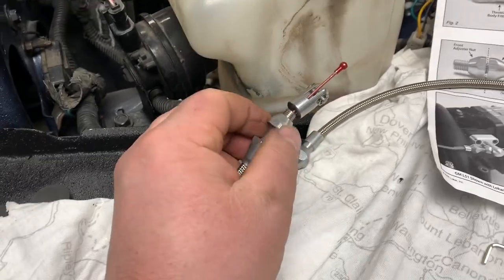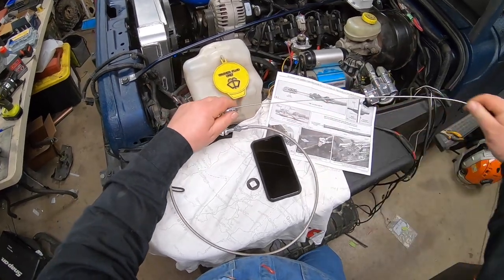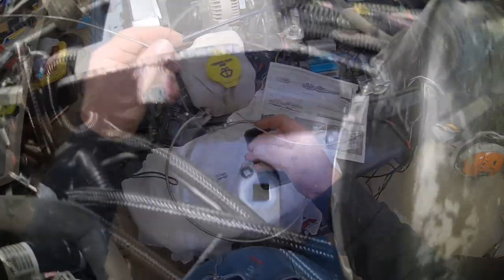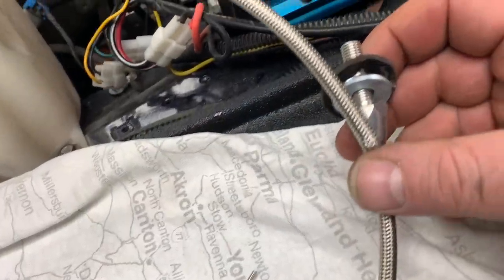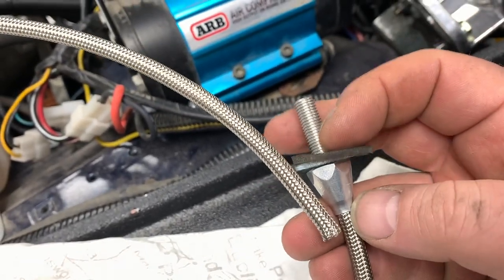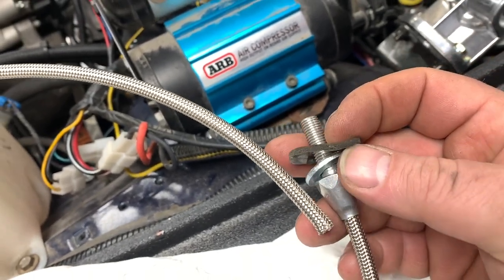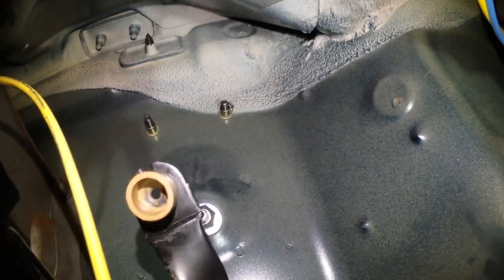I don't need the end that came with the kit, so I need to pull the throttle cable out of the sheath and get rid of that little piece, and then hopefully feed it back in without any issues. The throttle cable hole was actually quite large, so I grabbed some washers that weren't included with the kit — you need two of those — plus the foam rubber grommet that came with it, and then I bolted it through the firewall.